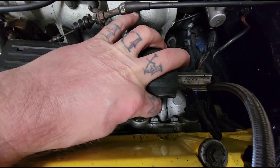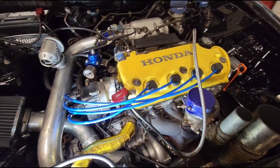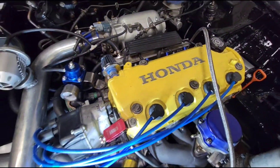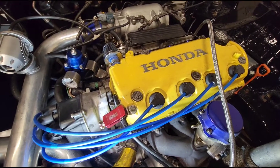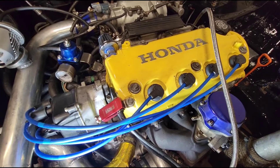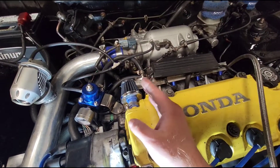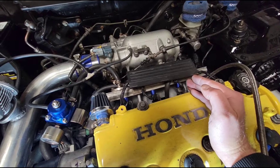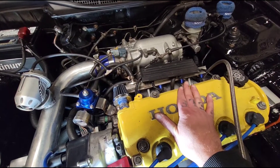We're also going to check that the injectors are tight. The boost leak test will find that. He is on decapped fuel injectors — basically guys in their garage take the injector, open it up more so it flows more. The problem is consistency. If you have one injector flowing a thousand CC's, one flowing seventy-five percent, one flowing fifty-five percent — the cylinders that are flowing less are going to lean out and ultimately you're going to cook your motor.